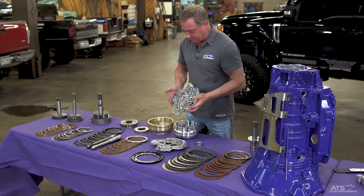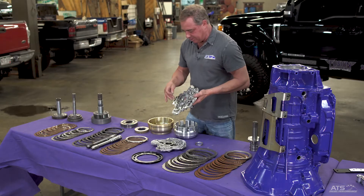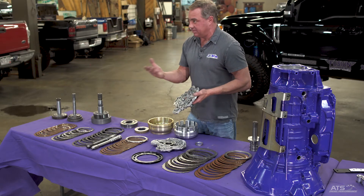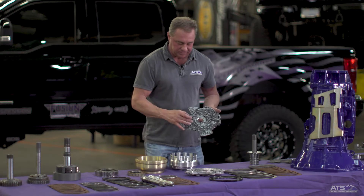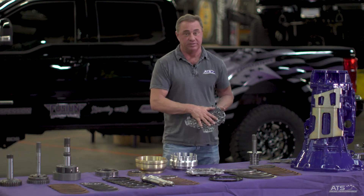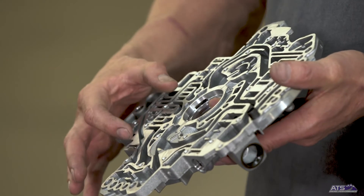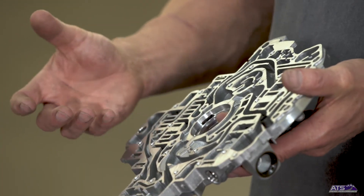You'll see a lot of familiarity with the valve body. You have your hydraulic ports — this is your lockup portion and your pressure regulator system. The pressure regulator is redesigned to essentially not wear out, using the same technology as the valve body. One interesting thing is the way Chrysler modulates its lockup control system — the lockup valve modulates at a frequency that has a tendency to wear out the valve body because of this modulation.